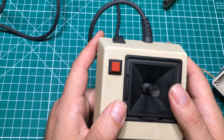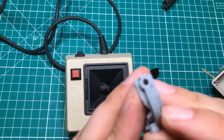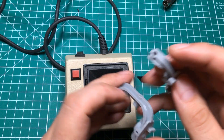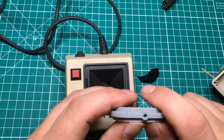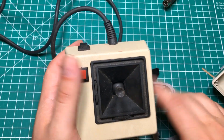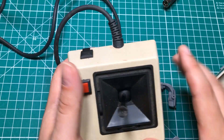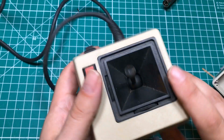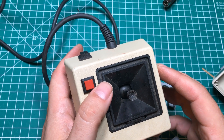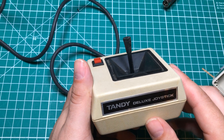Screwing the thing together, it does feel pretty decent. If somebody were to remix this, I would highly suggest making this hole on each of the parts just a little bit tighter. I think the PLA will give enough that you can force it on carefully, and that would give you a little bit less play in the center. For a joystick from the 80s that was just a complete pile of junk, fixing this thing up is pretty sweet. I'm going to clean it up in the future, but I just want you to know there is hope for these things, even if it's just good for light-duty use. Thanks for watching, happy Sept-Andy, and have a great day.